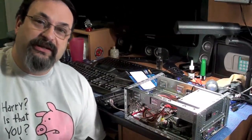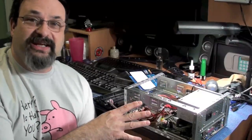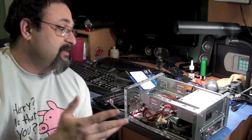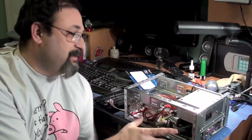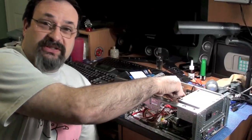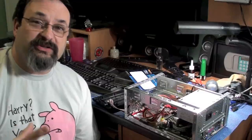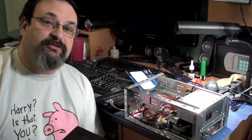And this will give this tiny little box some extra air because it's very tight. You have a lot of things generating heat, such as the fan and the CPU and the chipset. You know, got a huge heat sink and all these things build up heat. And then if you've got it tightly packed and closed up, it can get hot in there. So I want to throw in an extra fan.